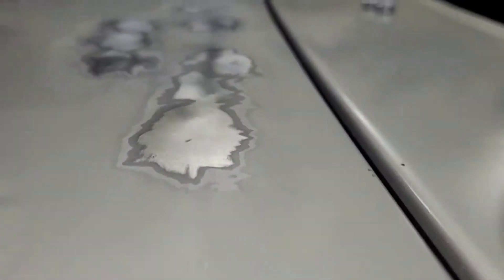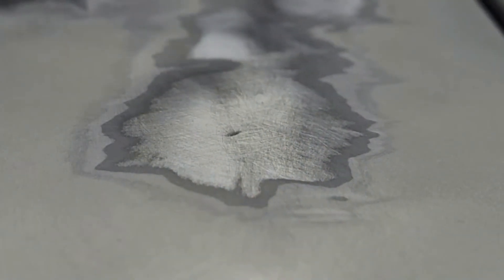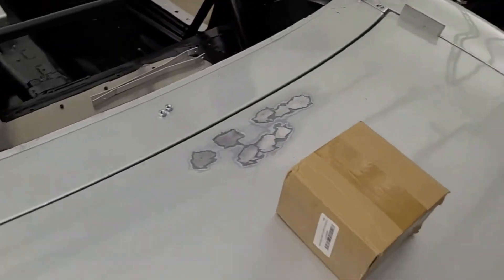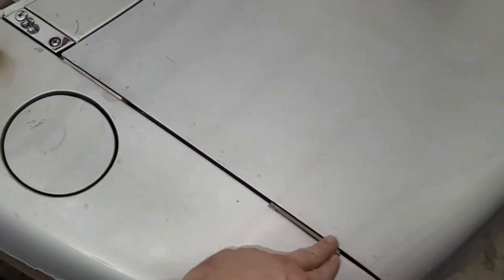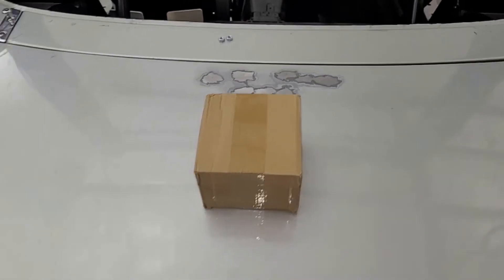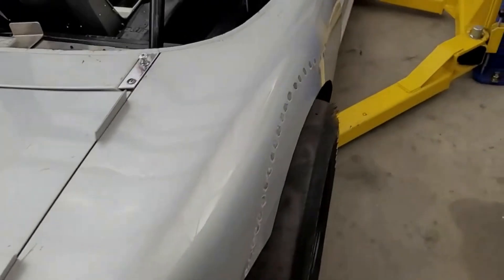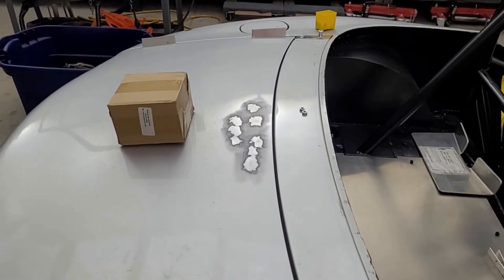Give it a little optical zoom - that's what it looks like up close. It's not horrible; you can see that little spot where the weld is, it needs some filler, and this whole area just needs to be lightly filled and sanded to get it level. It's fixable. We're going to try this - if we abandon it, we abandon it. At this point I'm going to cut my plates and install at least four more if not six more, doing the corners. We'll put one here and one here. It does warp the panel and create more work for sanding, so we may just do five. Onwards and upwards - not excited, but maybe this will come back around and be better in the end.